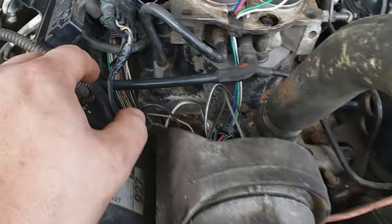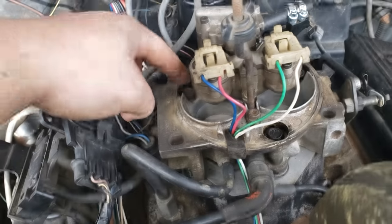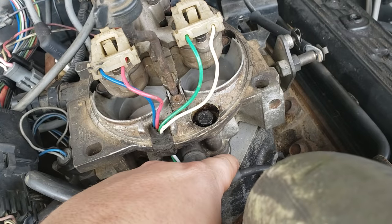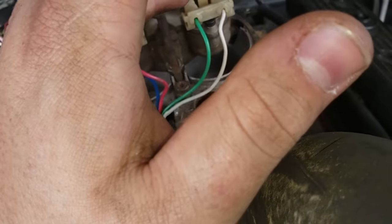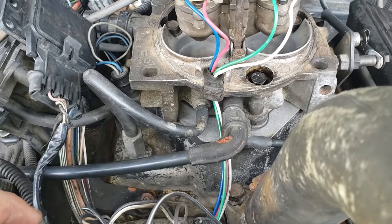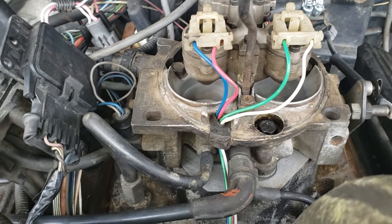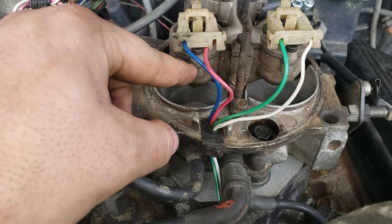And this motor in particular had a bad throttle body gasket. You take these three bolts off here, here, one back here, and this throttle body gasket gets old and brittle and just disintegrates. That will make it run bad. Not often, but it does happen, I guess. Maybe the injectors may get bad, or the gasket here.